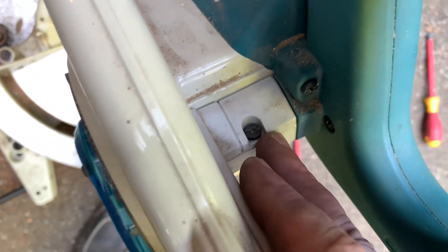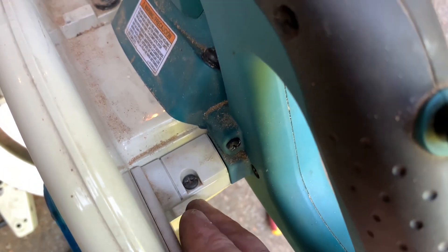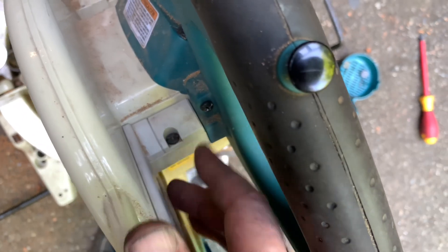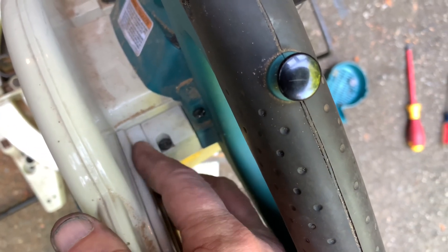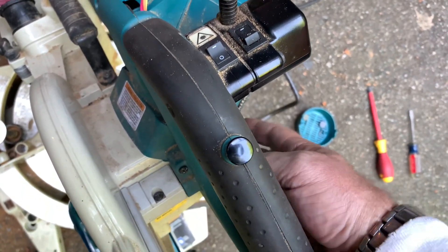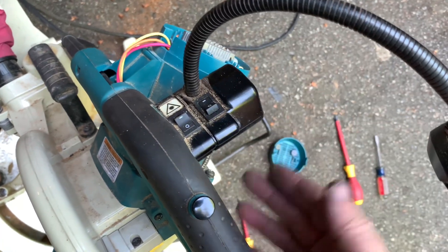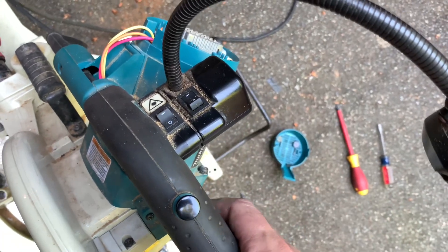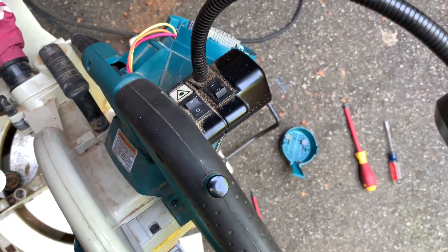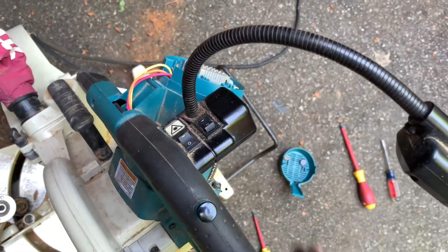What you do need is right here — there's a plate, and inside there's a connector. You take this off and this big plastic piece falls out, and you'll see that there are two wires and a connector. After you undo those four screws, this whole assembly just lifts straight off. You have to take the brushes out like I said, and at that point you'll have space to undo the connector. Then you can lay this aside and the whole armature is exposed.